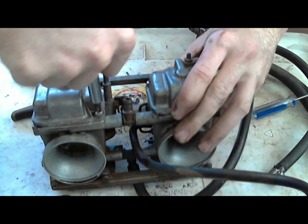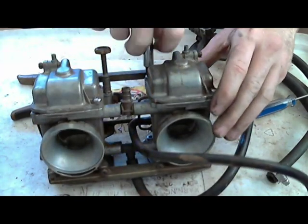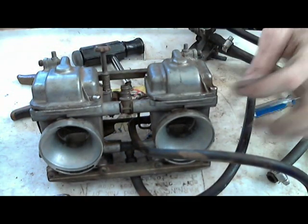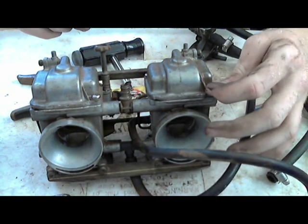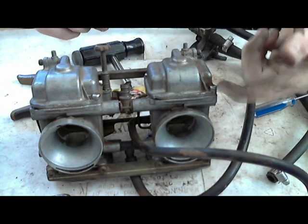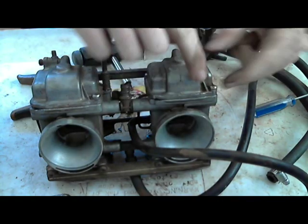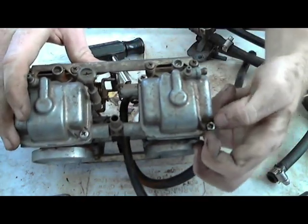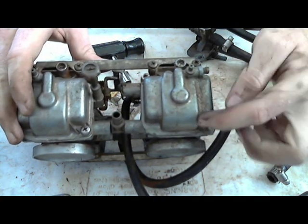If these screws are stuck whenever you're taking the carburetors apart, take some vice grips and put them on the side. Actually, what I've done before is use a drill bit and the vice grips, because sometimes the float bowl will curve around the sides. These are open, so you can put vice grips on the sides of these. But if you can't, because the float bowl comes around too far out to the sides,